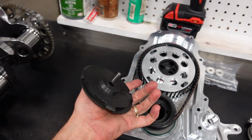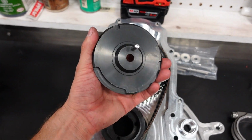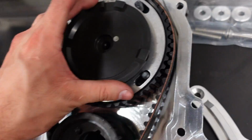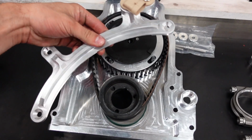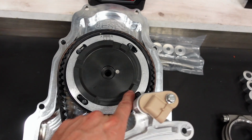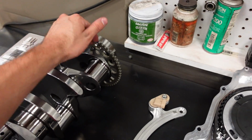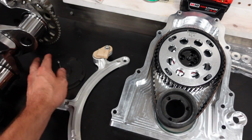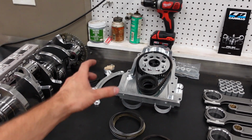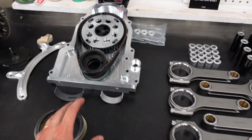Really quick, I'm going to circle back to this belt drive. ATI Racing, if any of you guys have a belt drive on an LS, ATI Racing makes this front hub that has a key that splines into everything right here. And then they make this bracket that bolts across the motor like that. And boom, you have a cam sensor that reads 4X pickup on your Jesel belt drive system. So I'm going to run a 4X cam and a 58X crank, so I can use a pretty simple standard Holley Dominator ignition system without having to worry about going with crank triggers, and it kind of opens up the door of ignition stuff.